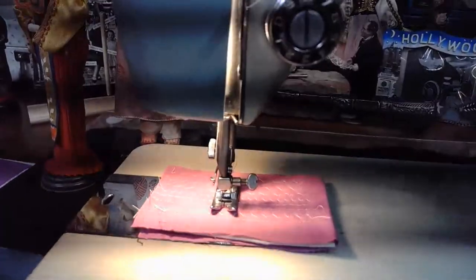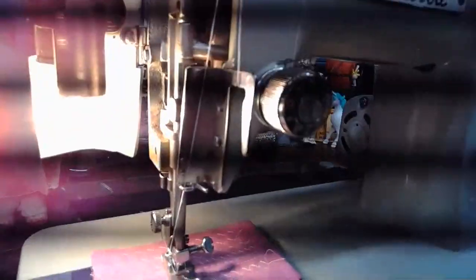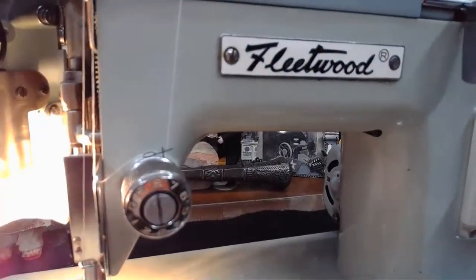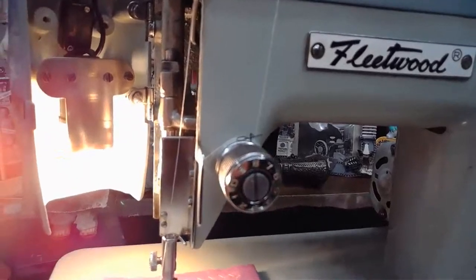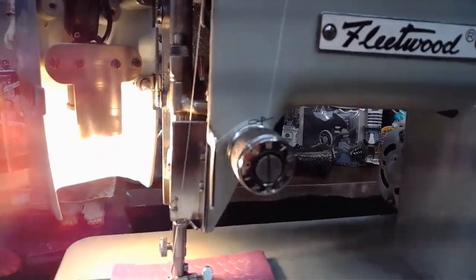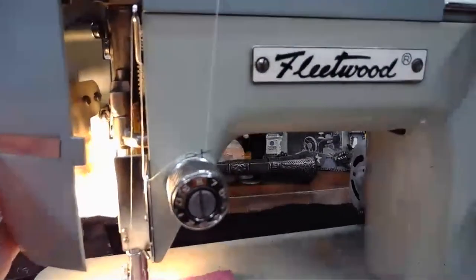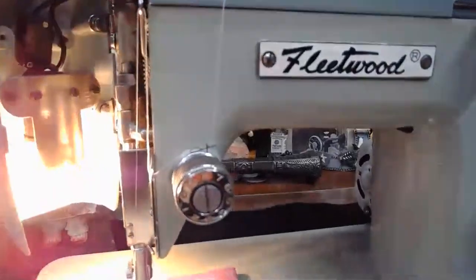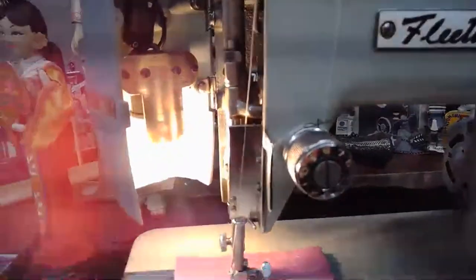And then this faceplate also opens, so we can get access to some of the key lubrication points on this Japanese machine. Let's just say that there are a lot of essential lubrication points in the faceplate, and I'm glad that when you open the faceplate on this particular machine, it doesn't have a thread guide attached to it. Then it becomes awkward, as far as, did I pull the thread out of position? Is it out of one of the thread guides? This one, you can open and close if you want to get in there to make adjustments or do maintenance on the machine as well.